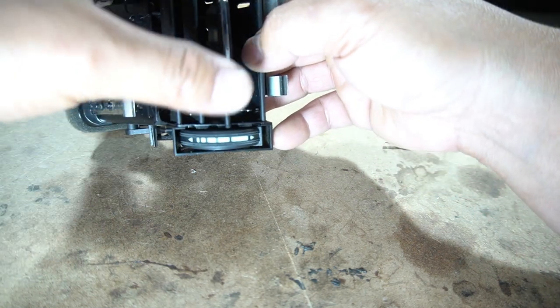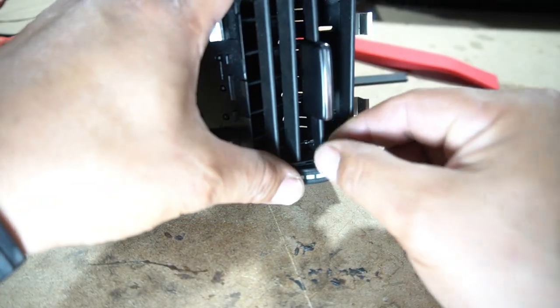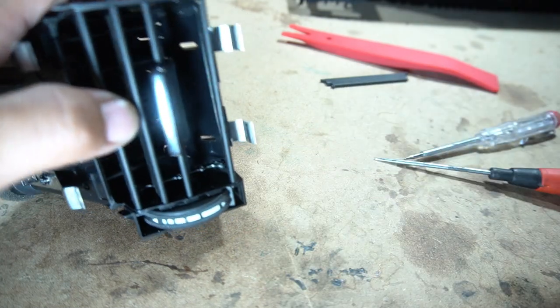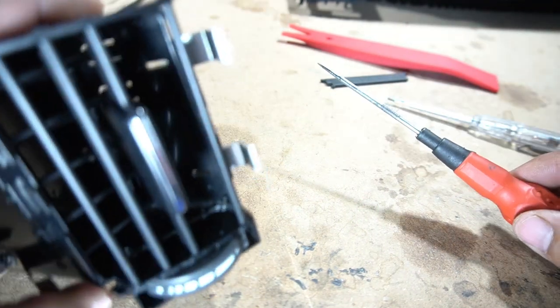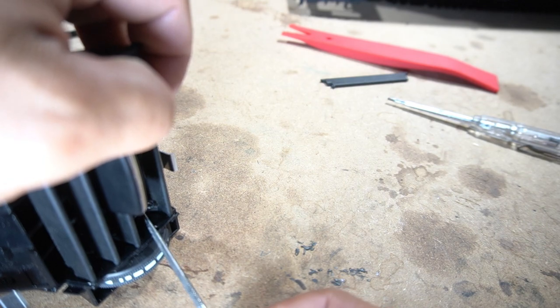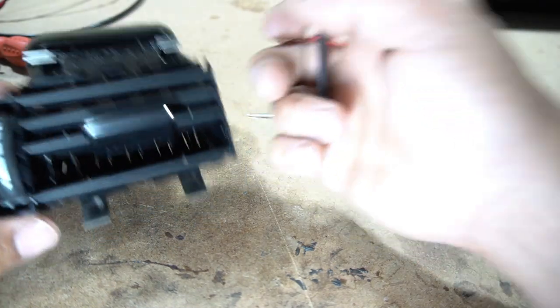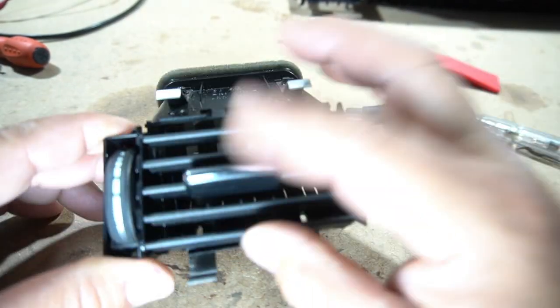Help that bracket over the clip. We need to help it by pushing it in and lifting it up at the same time — push down, then lift up the bracket and help it sit over it. Make sure it fits into the bracket, then pull it down. The hard part was that when you go to put this in, the bottom one also slips out, but that's not a problem because it's really easy to fix. Just lift it up at the bottom and put the bracket back on. Look at that — it's all back in now. For the last one, all you have to do is put it straight in, make sure it all lines up, expand it a bit and push it right in. Our air vent is completely put back together.